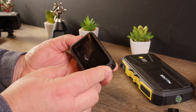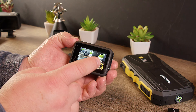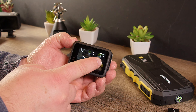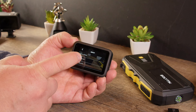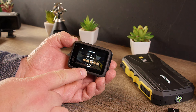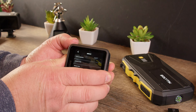I'm going to turn it back on and check if the new firmware is installed. That's a very easy check: slide to the side, preferences, and there's something called About - click on Camera Info. Now we see we have version 1.30, so it updated the camera to the new version. Let's turn it off.